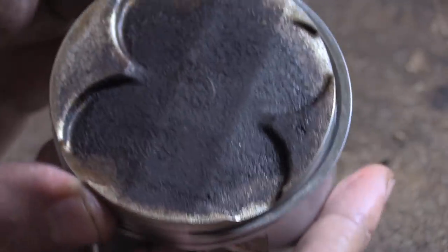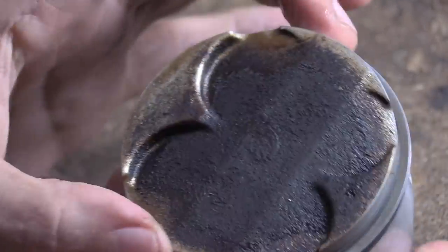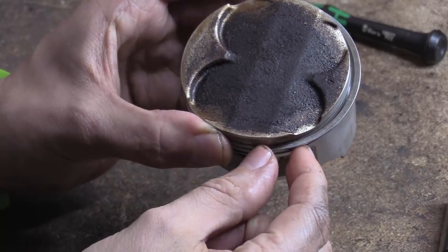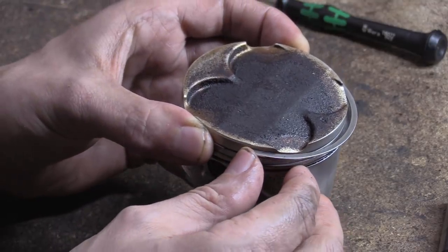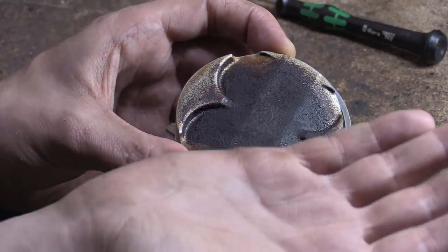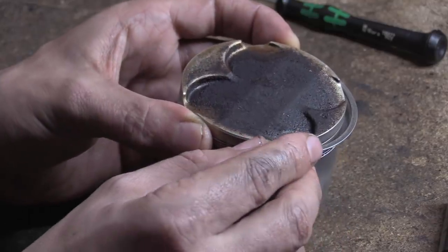Say we're at six o'clock here — just before eleven o'clock you push the ring. So what we're doing is pushing the top of the ring and pushing the rest of the ring out like this, and you'll see that the top ring just bows out. Then all you do is grab it with your finger and pull the ring out of the groove — pull it away from the wall and just let it glide up. Let go — don't twang it — just push it up like that and it shouldn't scratch the side of the wall. You should hear nothing.